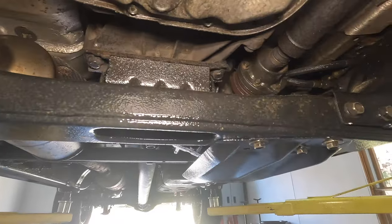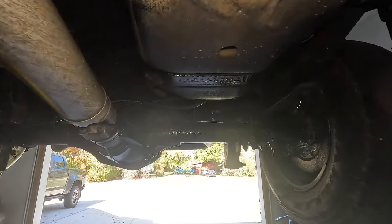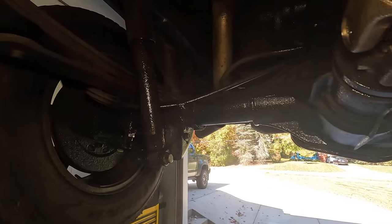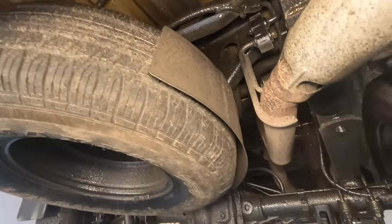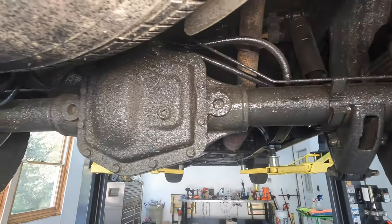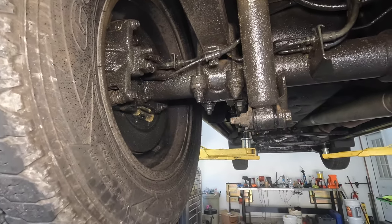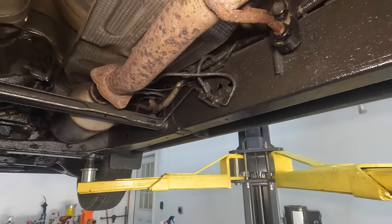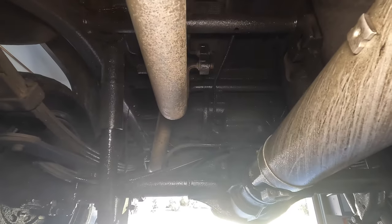There are no real changes — everything looks pretty much like it did when it rolled in. What I focused on was the front edges of all the cross members, because of water spray, just like the front axle. Those are areas that, even with Surface Shield, you're probably going to have to touch up every year. As far as the rest of this stuff under here, the backside of everything is still well coated, so I didn't see much need to go hog wild and spray two to three quarts. The reality is it probably needs more product about as much as I need a hole in my head.